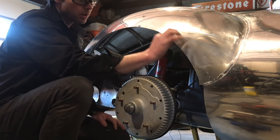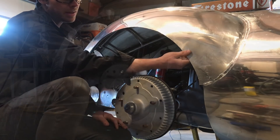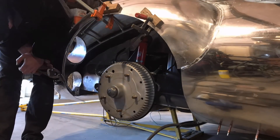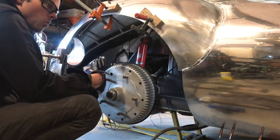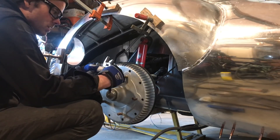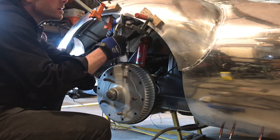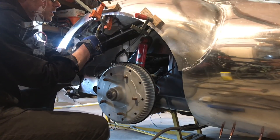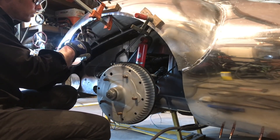We've got the lip of this wheel arch all annealed and now I'm going to come through and clamp this. Now I'm going to use that buck to start setting my edge in. I just do this with a simple pair of adjustable channel lock pliers, just like that. I go every couple inches like that — you can see how nicely this forms once it's annealed. And once you get that crease set in you have a good point to kind of hammer from as well.